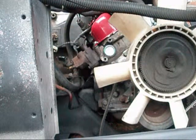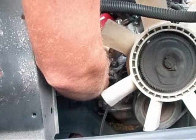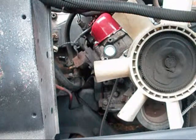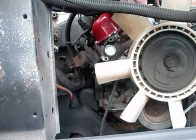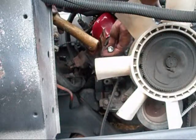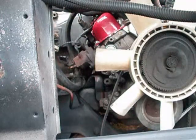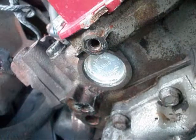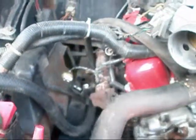So you see, we just got started. At this point I'm going to take a little tap with the hammer around the lip of it to finish pressing it in there evenly. Now we're going to get back to our homemade press — the 23mm socket on the extension — and go ahead and finish tapping her in there the rest of the way. Let me take this moment to see how far in I'm at and double check myself. And there's your changed freeze plug. You just put your alternator mounts back on and cover it all back up again with all the mumbo jumbo that needs to run the rest of your vehicle.